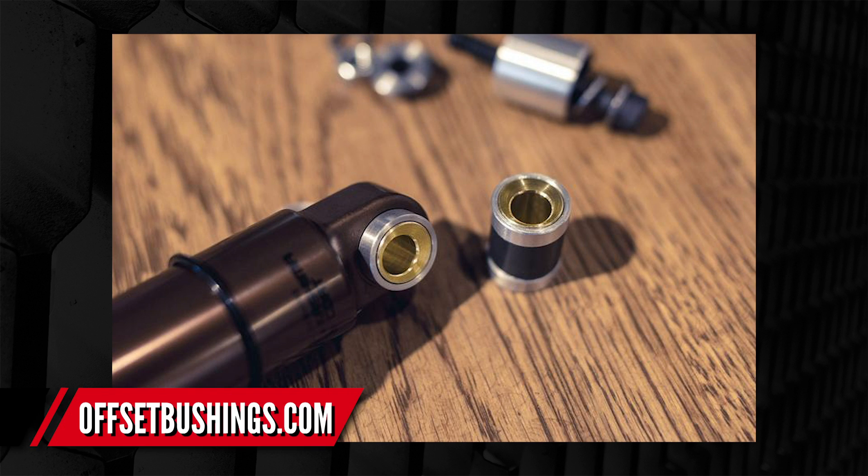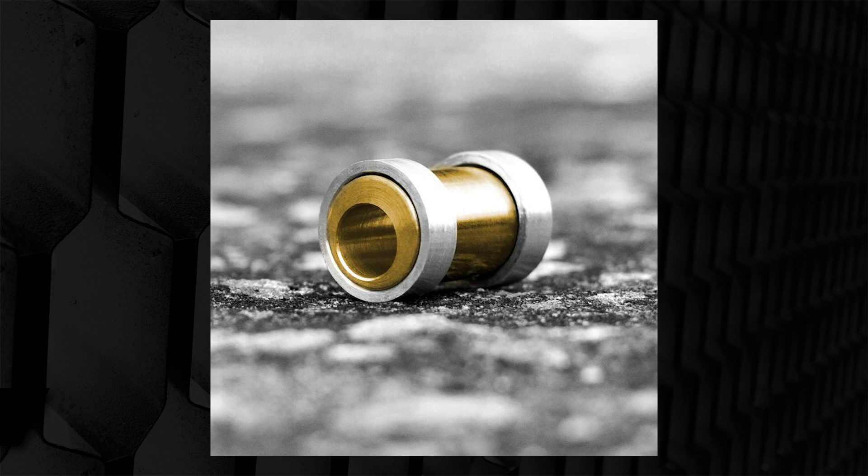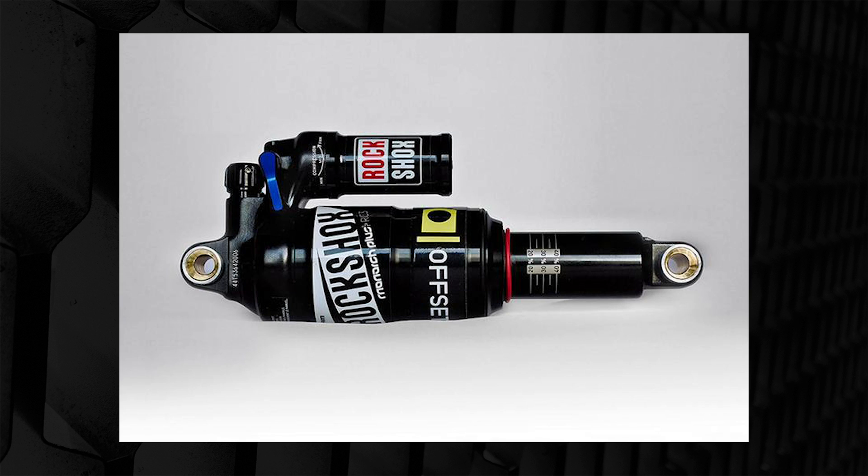I'm throwing you to that on screen now. You can see where the bushings go into the shock eyelets — the bolt goes in offset and it just buys you a little bit of space to slacken off the head angle a little bit. You haven't got as many options as you do with angled headset cups, but it will definitely slacken it a little. As an upside it will also lower your BB a tiny bit, but as a downside it will slacken your seat angle very slightly because it basically tips the whole triangle back — whereas when you slacken the headset off, you actually steepen your seat angle because the frame drops slightly as the fork extends.